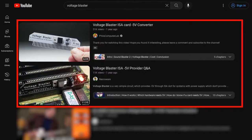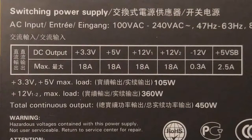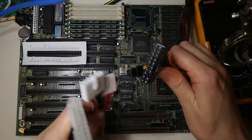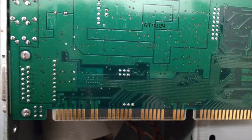The links are in the description. In short, old AT power supplies used to provide negative 5 volts to the motherboards. ATX power supplies don't. So if you are powering your old motherboard with an ATX to AT adapter cable, then your motherboard won't provide negative 5 volts. Some cards require minus 5 volts to work properly, which is why you need a Voltage Blaster.